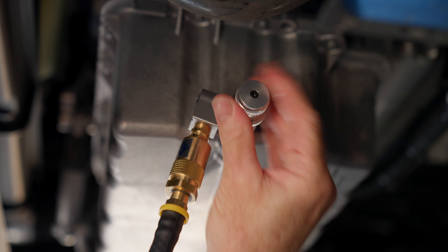All right, first here we're going to take off the dust cap. We're going to grab the tool and install it up on the drain pan. We're just going to snug it up once it gets tight — just a little bit snug with your fingers. We're just going to screw this knob in to start releasing the oil. Just like that — just snug it up. And we're just going to pump and oil will start coming out.